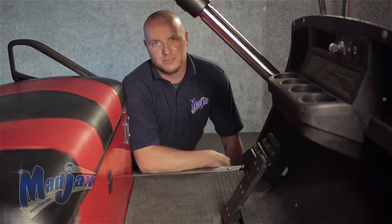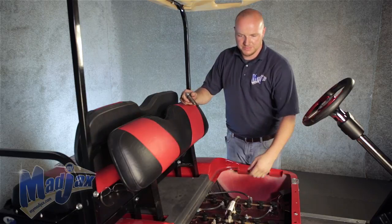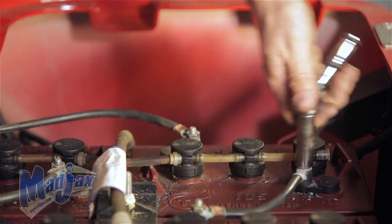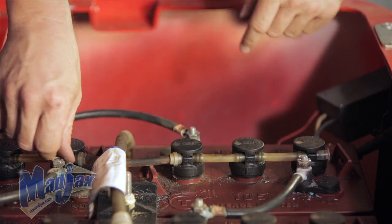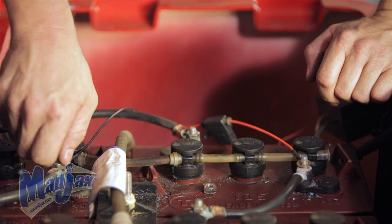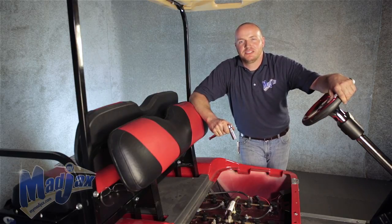Now that our brake pad is attached, we're going to hook up our harness to our battery terminals and we're done. We're going to switch the cart into tow. We've already used our multimeter and found our 12 volts. If you have an 8 volt battery pack, you need to use a Mad Jack 16 to 12 volt reducer. We have a 6 volt battery pack system, going from the positive here to the negative here — it gives us 12 volts. Red to the positive, black to the negative. Now that we have our harness attached to our batteries, you're finished installing your Mad Jax Ultimate Light Kit designed for an EasyGo TXT.